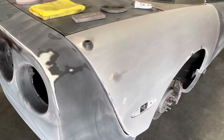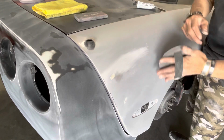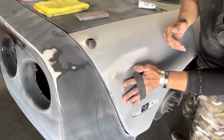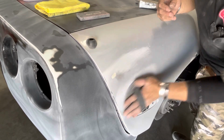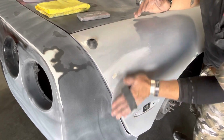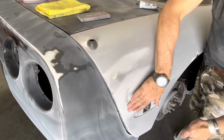All right, so the first thing we're going to address over here is, after the glazing putty, I'm still doing some hand sanding, okay? Not putting a lot of pressure, still letting the sandpaper do its job. Your job as the sander is to make sure that this pad just lays flat to its surface. Let the sandpaper do its work, do a circular pattern, wax on, wax off, Karate Kid type stuff. It's going to take a little bit until it sands that away.